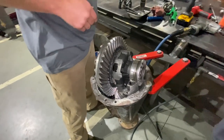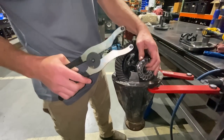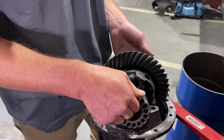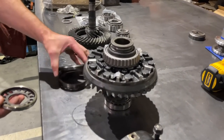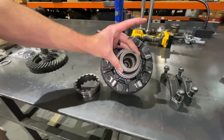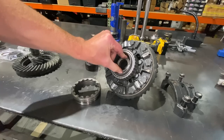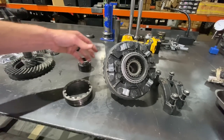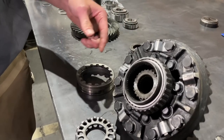We did wash this, which is helpful because it takes care of some of the oil. Here's some pliers — these are ARB ones — that will help you break the adjuster loose. On this differential, you can't get anything mixed up because everything is different sizes. Here's your locking collar. That's what it's engaging to — so this is out, unlocked, and as it slides in, it's locking to this side gear and splining here. So the side gear is then locked to the case, and that's why it's spinning all the time. I can turn that without the ring gear moving — that's your spider gears rolling around each other. Carrier's out.